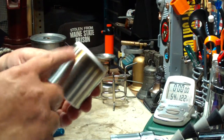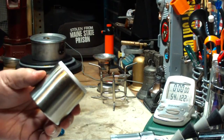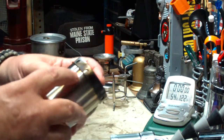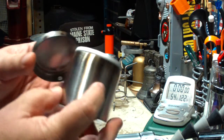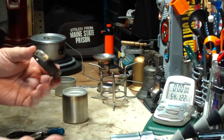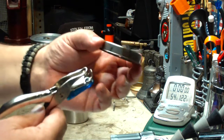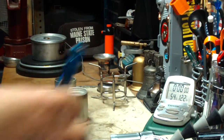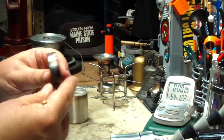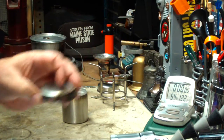So on the burner there are 18 jets. I thought if we could block, say, half of them — make nine jets work — that maybe that would be a simmer mode. So what I did was I put this lid on, marked lines where the jets are, and lined it up on the lid. I cut it by half, so that's nine holes. I made nine holes using a regular paper punch — this tin is thin enough to get through it. But instead of punching all nine holes, I only punched five, just to see what this does. If it looks like I need more holes, I can punch them in later.